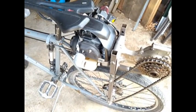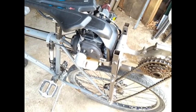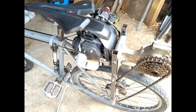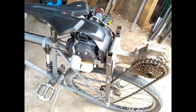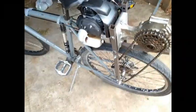So I've got to replace that. Unfortunately, it's really hard to find just a spring for this motor — you have to buy the whole clutch. I'm going to look a bit more to see if I can find a compatible spring, maybe from another brand of weed whacker, since they all have similar clutches. But anyway, that needs to be replaced.